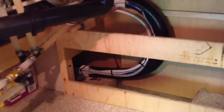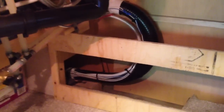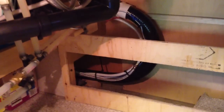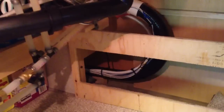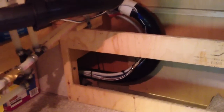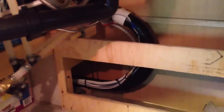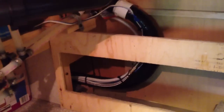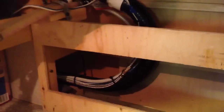This flexing that you're seeing in that big black tube is what caused this problem. The RV is about six and a half years old now, and so that pipe has flexed — that's what old slide outs sound like too. You can see how that pipe flexed in and out to accommodate the kitchen being in the slide out. We never knew that, and what happened was we came home to find water dripping from this old pipe.